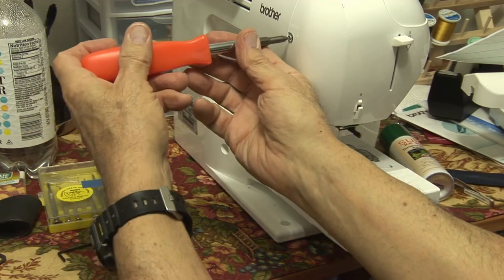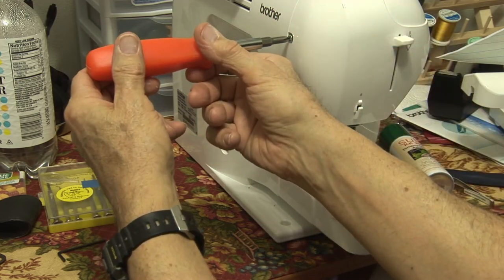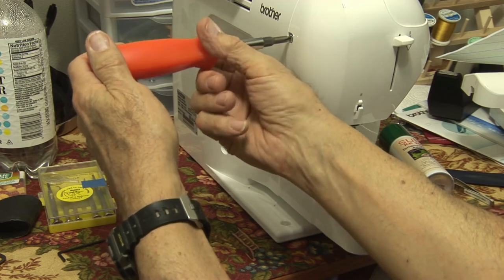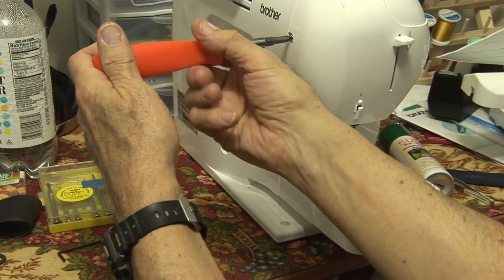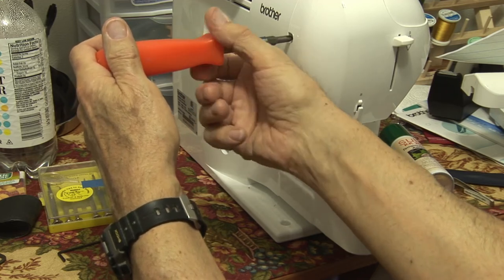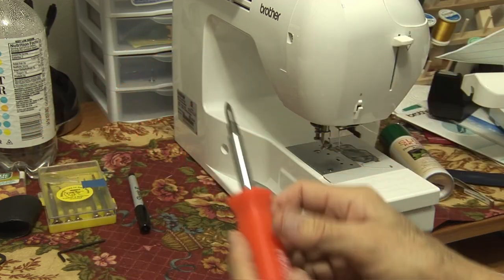All these screws, you do not have to over-tighten. Just make sure your screwdriver is parallel. Not like this. You look and you concentrate, make good contact, and you bring it in, jiggle this, make sure it's in, bring it together like this. All right, you can feel it now, it's starting to snug up. And you don't go nuts with it because you've got a plastic part, you just snug it, okay?